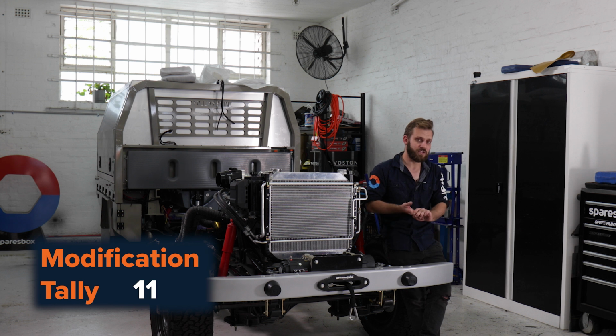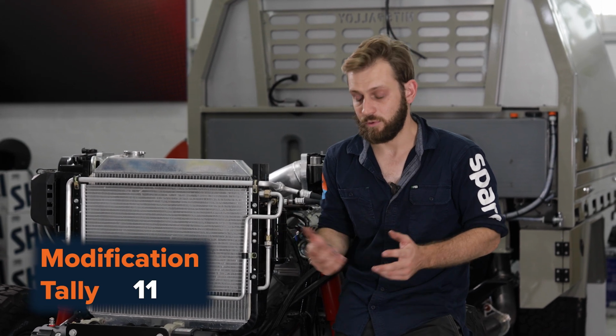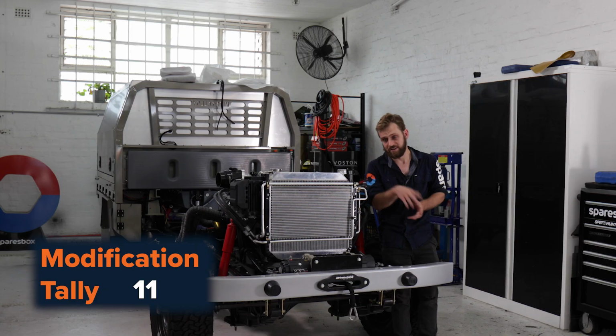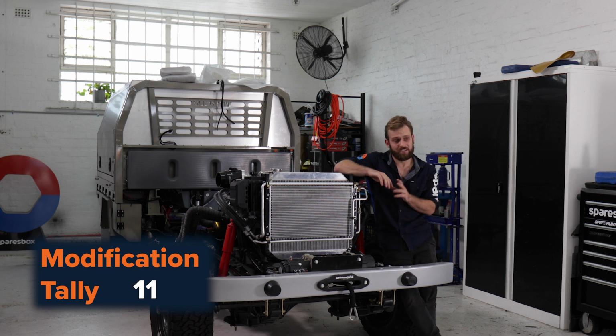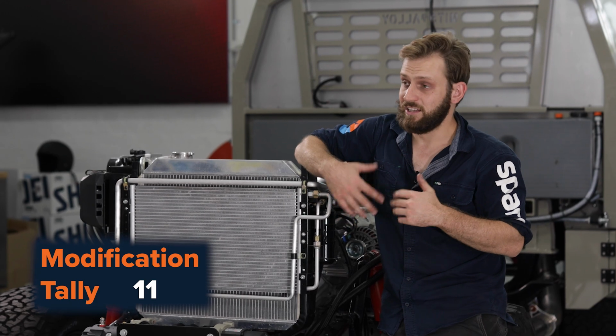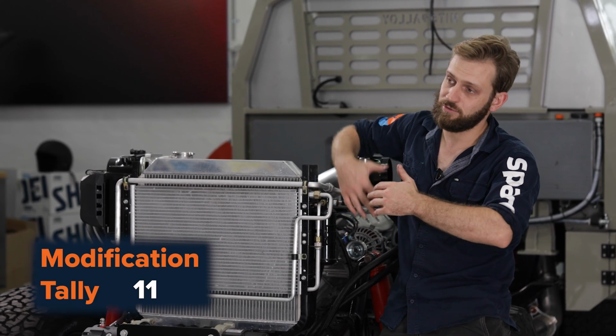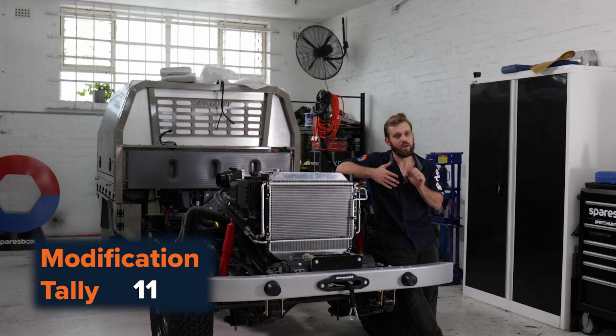Another requisite of the gearbox was we wanted it to have a 2-wheel drive option as well. So we didn't want permanent 4-wheel drive. We want to be able to put this thing in rear-wheel drive. And the R151F caters to that. Another fantastic thing about it is the range selection is in a straight line, which means that the linkage to move the range selector forward into the cabin of the FJ was really easy to make. It only has to move on one plane.